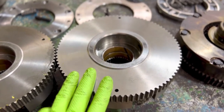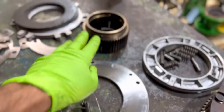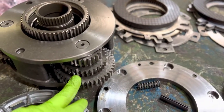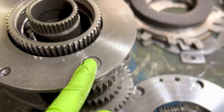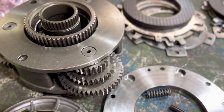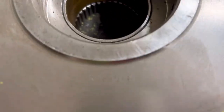If you have to upgrade, say, this C4, sometimes you have to upgrade the sun gear. Then when you upgrade the sun gear, you've got to upgrade the planetary gears. When you upgrade the planetary gears, you've got to upgrade the pinion shaft. The pinion shaft leads to the carrier, which leads to more — it's just a never-ending piece.